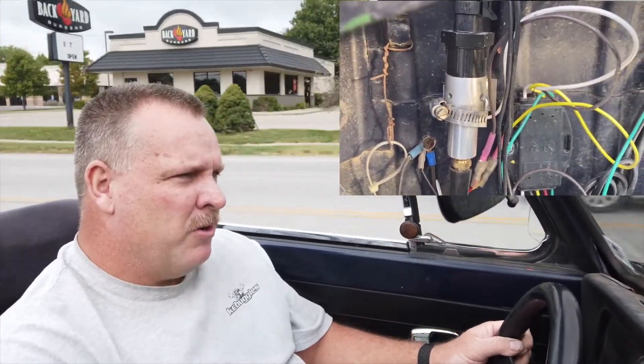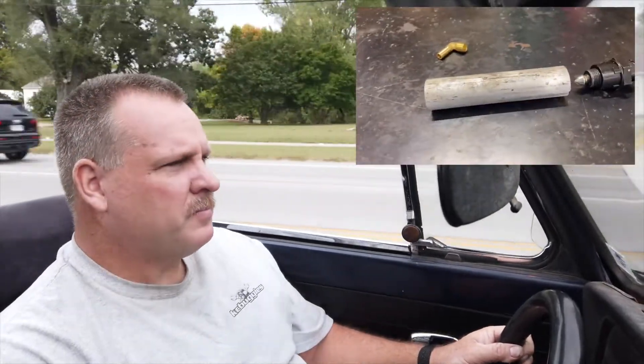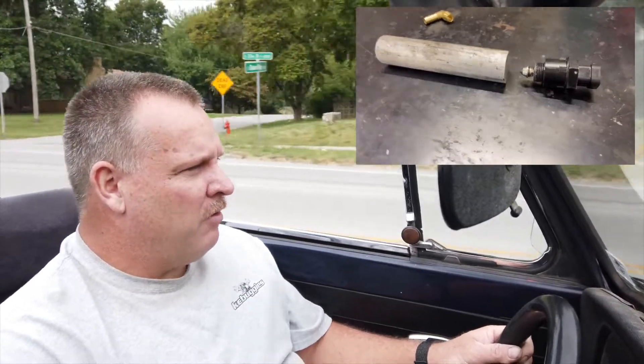One thing I forgot — my idle speed control. I'm running a four-wire GM stepper motor style idle air control. I custom made a housing to fit it — took a chunk of aluminum and machined it down to fit the valve, and wired that in with the stepper motor control. I have a hard time getting closed loop idle working; it hunts and surges a lot. I'm open to input on what we might be able to do to help with that. Right now I've got it running in open loop mode, and honestly I think I've got it tuned pretty well. It starts up nice, and as it warms up that valve closes down. Between the four-wire stepper motor and running advanced idle control where I'm adjusting timing, it really seems to have a nice smooth idle all the way through the temperature range.